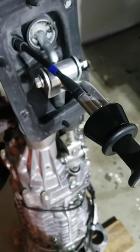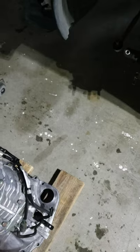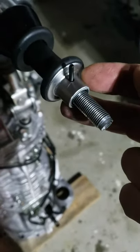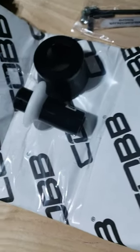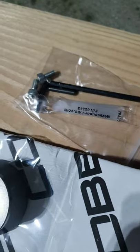I'm doing the bushings now and the short throw shifter. I got a Cobb shifter. You have to take a 3/32-inch punch — you could probably use a little bit bigger one. This pin goes all the way through and holds the reverse lockout onto the shaft. I got the Cobb reverse lockout, which replaces that whole thing onto the Cobb shifter. It has the actual lockout piece, new little screws, a hex head tool for those, and a new pin to drive through to hold it all onto the Cobb shifter.